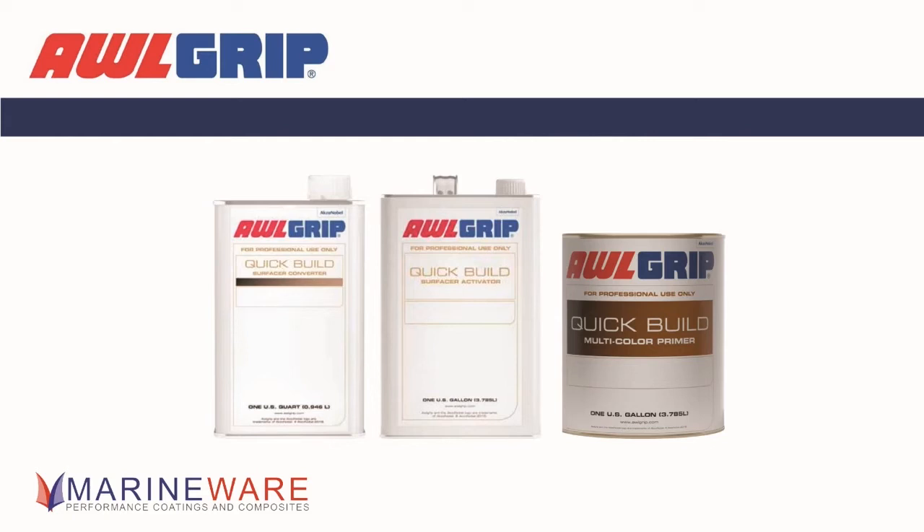The surfacer is a bit more like a 5-4-5 type product — you put it on and sand it. How quickly can you sand it? It's an hour, working at about 23 degrees. To put it in context for people, it's a good analogy to say it's similar to 5-4-5. You might use it on top of aged top coat, a GRP structure, or aluminium. It's not meant for use over fillers, just to manage that expectation. It's about a quick system.